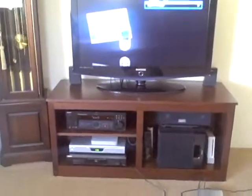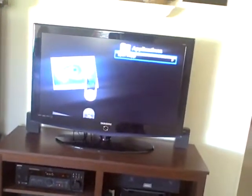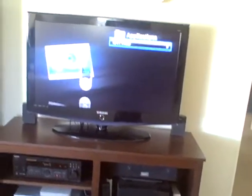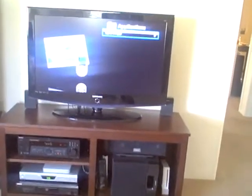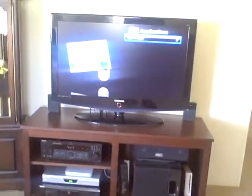I haven't tried too many versions of ITV because for the most part the Apple TV OS is Tiger, so you can't go past a certain version number of ITV — that's when they added Tiger support. You have to fool around and try to get it working. Also, the OS on the Apple TV is not fully updated; it's not 10.4.11. So certain versions of ITV require components that are in 10.4.11 and it complains.